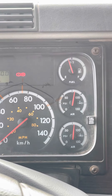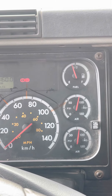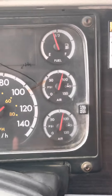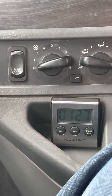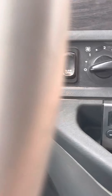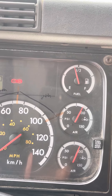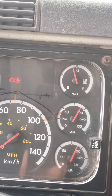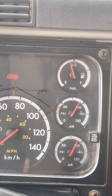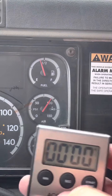My low air warning light and buzzer turned off around 80 PSI — it's not really necessary to mention that, but it doesn't hurt. Waiting to make sure that we can reach 90, which is roughly there, in at least three minutes. That's 90, and we made it there with a minute to spare.